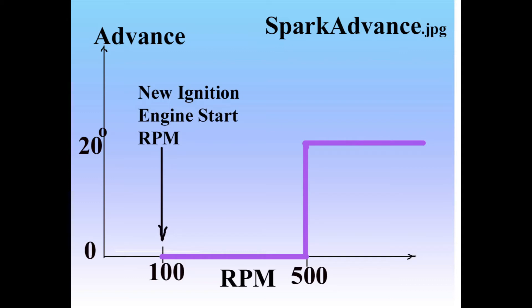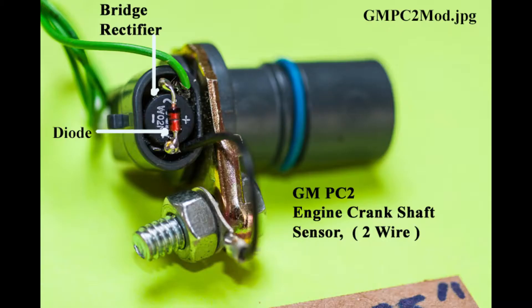It is easier on a battery and the starter motor. The GM PC2 crank sensor is an induction type coil, and Hall effect type coils would not be suitable for the RPM-controlled level of spark. I have several PC2s already, but some conditioning is required to have them work with the LS2 ignition coil.